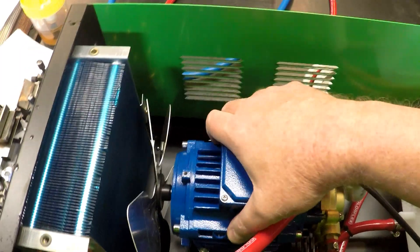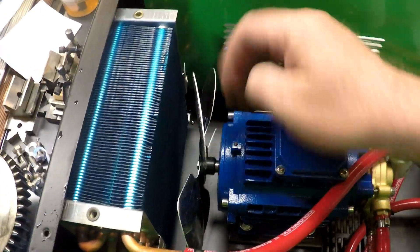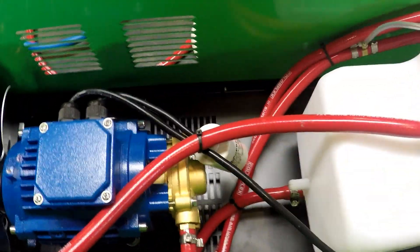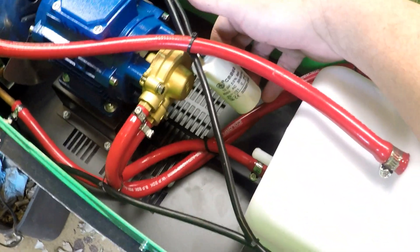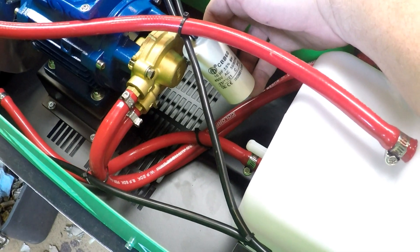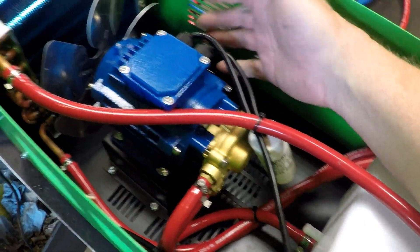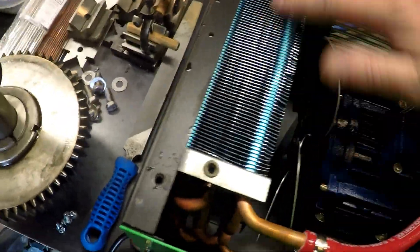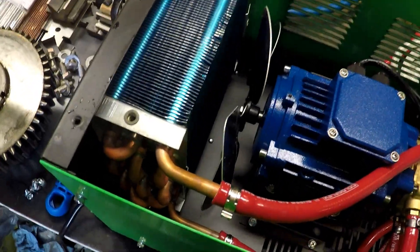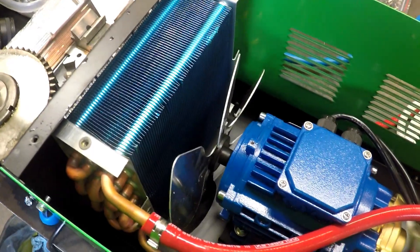Typical of a lot of these water coolers, here's a motor doing double duty. This is a 220-volt unit; it has a start cap on it — 10 microfarad, 450 volts — wired in nicely with a gland fitting. All in all, pretty nice. The radiator here is a little three-row, which is pretty nice. Anodized fins — all in all, pretty good. I don't have power to it quite yet, so I can't fire it up and let you know how loud it is.